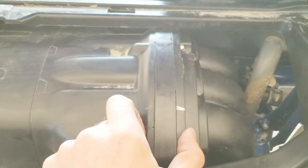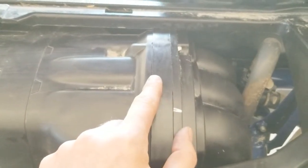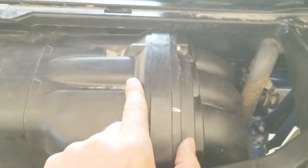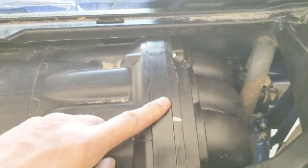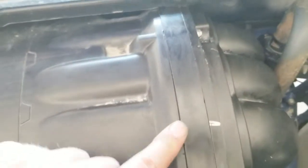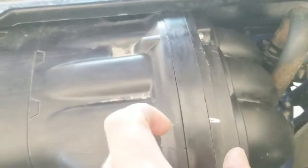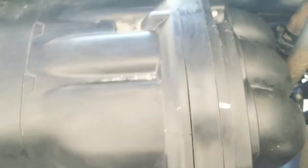I watched a Side by Side Blog video about putting in an Alba spacer — theirs was aluminum and didn't even have any gaskets, so it slid in nice and easy. But you've got to be very careful getting this thing in without pinching those gaskets. The one on the spacer stayed in fine; it was the one on the cover that didn't stay in so well. Everything tightens up nice though — it basically just crimps together on both ends, and that's what gives it a seal.